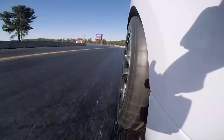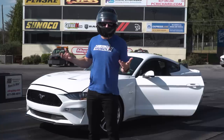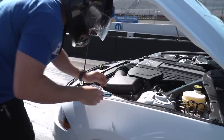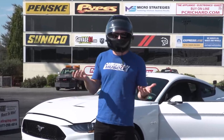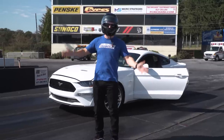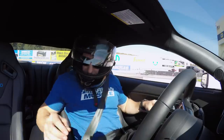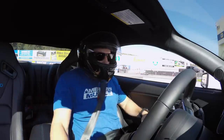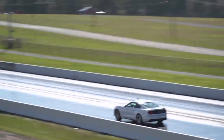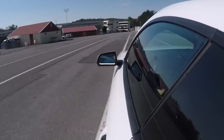Kind of fell on its face — didn't like something. The car left all right, could have used a little more RPM, but when it hit second it felt traction-control related. So I'm gonna unplug the dyno plug we usually use at AM when we dyno a car. The electronics on these things are so advanced that even with advanced track turned off, sometimes it still gets into those nanny modes. I'll eliminate that from the equation 100%, rerun it with the radials.